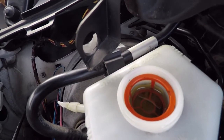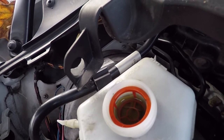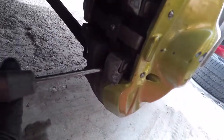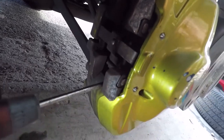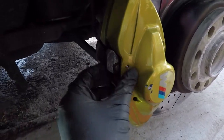I've got a lot of brake fluid in here so I'll need to take most of it out, because as soon as I push the pistons back the brake fluid will overflow. Now I've got a flathead screwdriver in between the pad and the disc — keep an eye on the caliper piston going back. It's gone all the way to the back. Let's do the other side the same way. The pads have been moved back, so now I'll remove the pins.